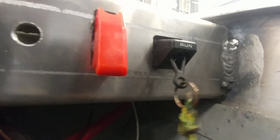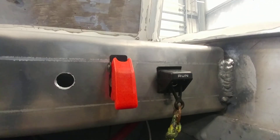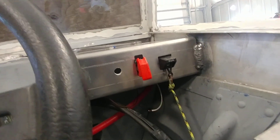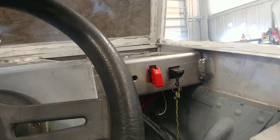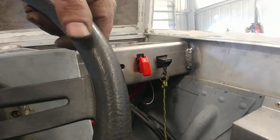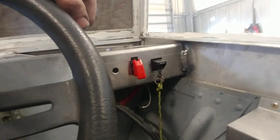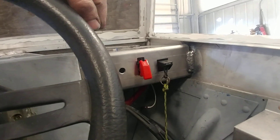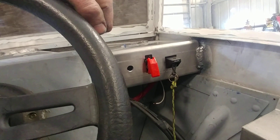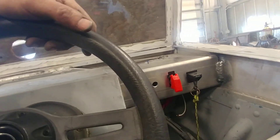When you get kicked out of the boat — which is always bad — if you're wearing this kill switch lanyard, which you should be, it'll shut the motor off instead of shooting the boat up the bank. You should always wear your safety lanyard. I use a piece of paracord with a carabiner on the end because those coily plastic things are a joke — the sun eats them and they're not reliable. I put mine on my belt loop whenever I'm about to do something suspicious. For example, if I even point the nose of the boat towards the Santiam River I put it on because it gets shallow.